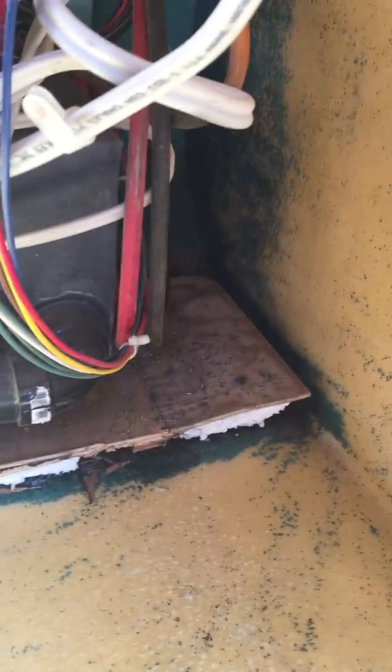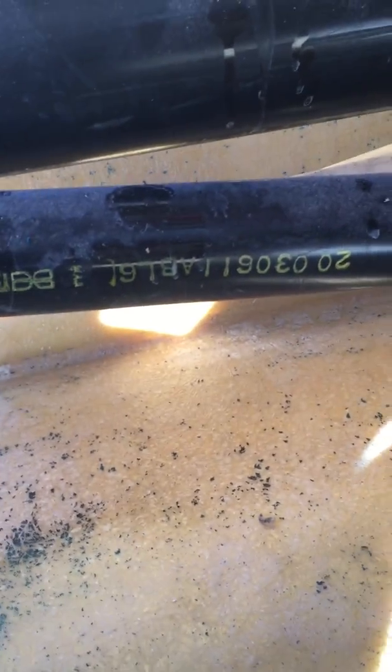What was happening is they only used this foam type to strengthen this hole in the back, and as you can tell it was already buckling. This is due to the pressure of the camper itself — it was buckling there, and for some reason it was sort of breaking over there as well. So I cut all this out and stripped the whole mechanism out.